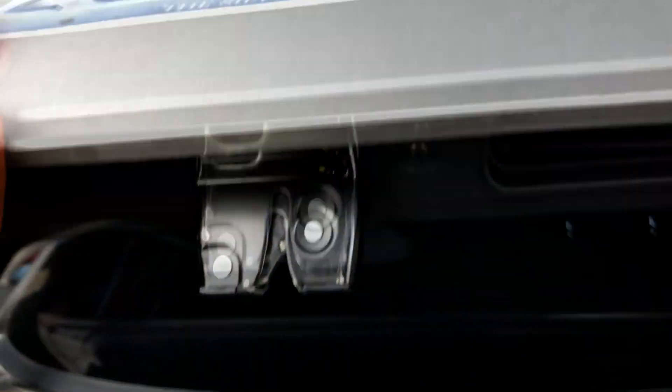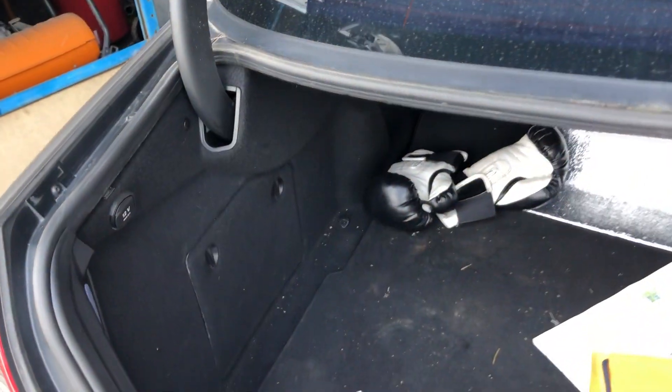At night these don't work either, so that's the main reason I'm going at this. I looked online and apparently it's a fairly common thing with these W211 platforms. One of the wire harnesses for the trunk goes through here, and when you keep closing and opening the trunk it keeps bending the wire, so after a while they get cut. We're gonna go ahead and fix that today.